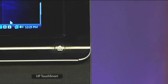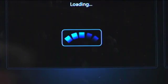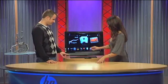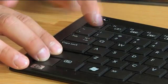Now I'm going to show you what you can do if some of your HP TouchSmart applications just aren't responding. Touch the Home button in the bottom right corner. When you launch that, you'll see a blue arc going back and forth, which means it's loading, trying to pull up all the applications in HP TouchSmart. If that's there for a long time, the first thing you can do is press Control-Shift-Escape to bring up Windows Task Manager and end the HP TouchSmart application task.